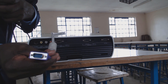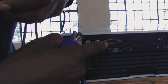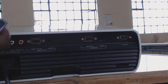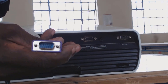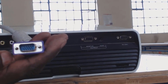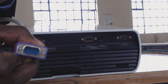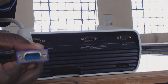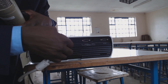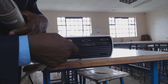There's one feature I'd like you to be aware of. When you look at the VGA port, you find that it is longer at the top and shorter at the bottom. Look at it closely and you'll see that feature — you'll also see the same feature on the end of the cable. The top length is longer and the lower one is shorter. Just like we did with the power cable, you're going to rotate it so that the short one is at the top while the long one is at the bottom, and then you push it in gently. If you do it forcefully without observing that feature, you may spoil your projector.